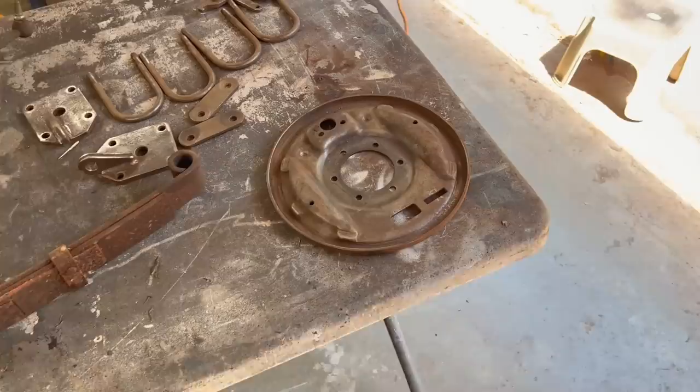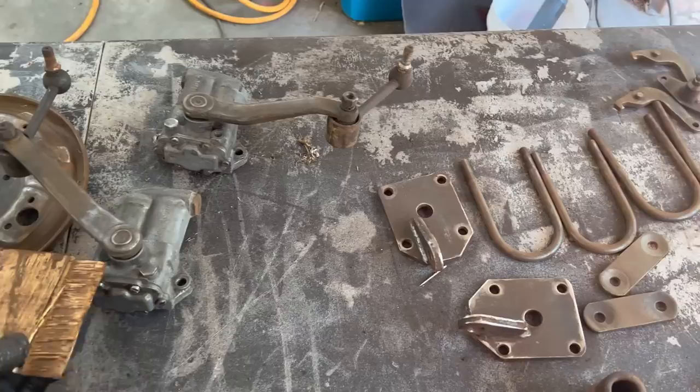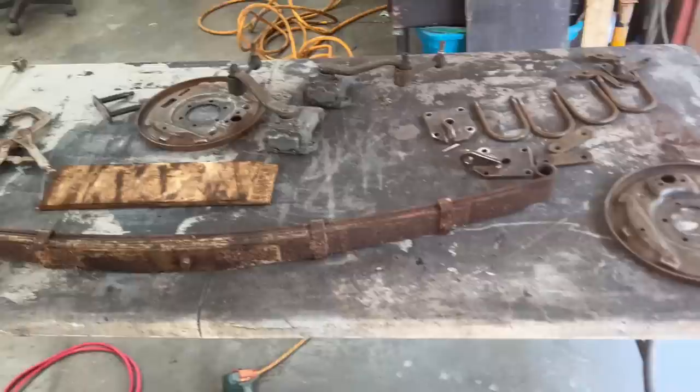We'll basically wash them with soap and water, and then we'll hang them in the tent and give them a couple coats of paint. We'll probably work on the lever shocks. We're going to split the links, and we're going to pop the tops off. I did bring some fork oil, so we're probably going to exchange the oil in these shocks. I'm sure it's probably the original oil. So we'll have a look at those probably before they go into paint. So we'll hang up what we can paint, and we'll bring you back and probably show you the shocks.